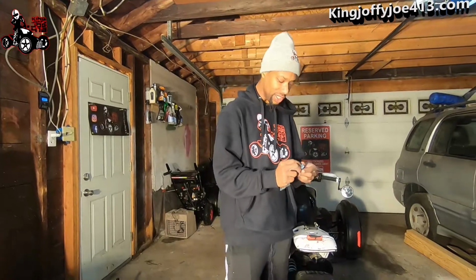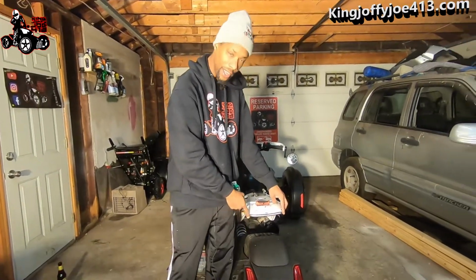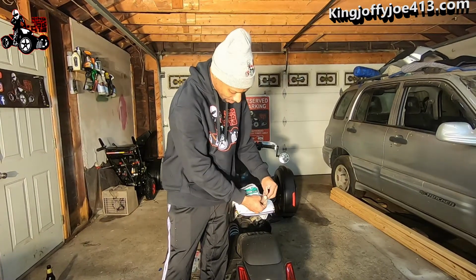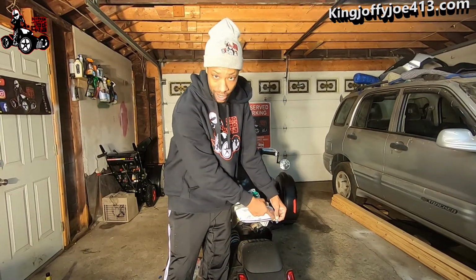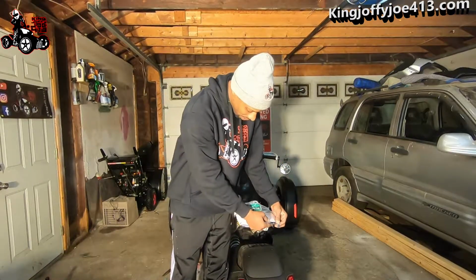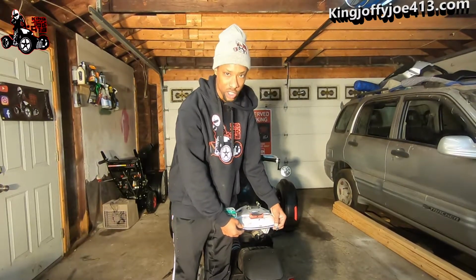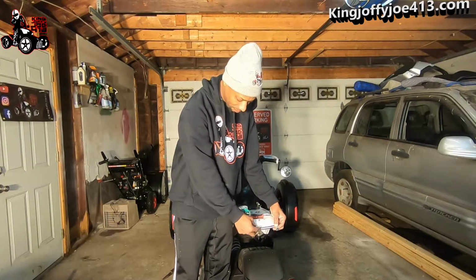What I did was I took a piece of cardboard the size of the light and lined the brackets up where I wanted them on the light, and made a little template. So when I put the 2-part epoxy on, I had the brackets on the cardboard template, so it lined them up where I wanted to put the brackets.